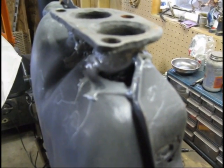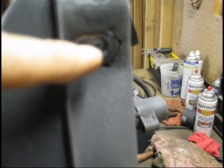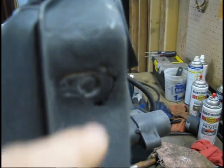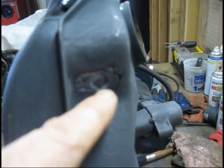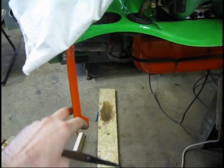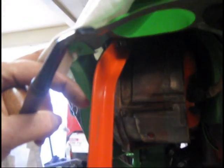We've got one last huge hole to fill — this is going to be the end of the patching process. I've got a bolt broken off in here that I need to extract. I'm going to try to drill it and use an easy-out; if that doesn't work I'll try something else. These bolts seize in there from all the heat and rust. I've got another broken bolt here that holds my pipe on the riser, and this other bolt holds the alternator adjusting arm bracket — I need good support on my alternator.